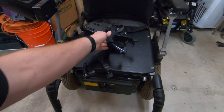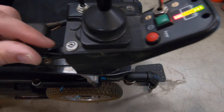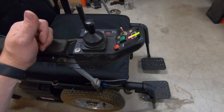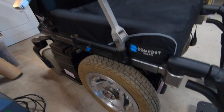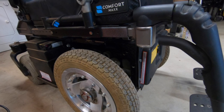They sort of swivel around, which isn't too big of a deal. I could put a Simpson tie between these two to sort of hold them together. Let me put the rest of this stuff away, grab a cushion, and we'll go try this thing out. Okay, let's power this thing up — we've got two power switches, the auxiliary controller and the main controller. There used to be a speed pot here but I broke that, so I ended up soldering it directly on — it's set to the full speed position right now. The front end is almost touching the wheels, so all I have to do is fill up the front airbags and this will raise back up. There we go — and it's got a dump valve as well.